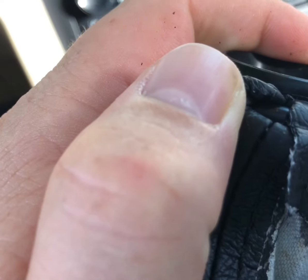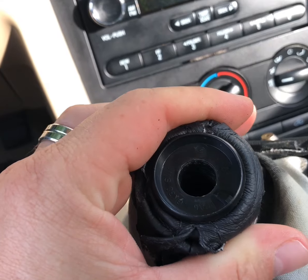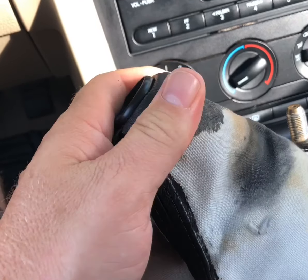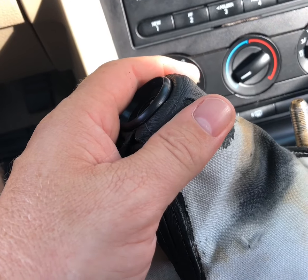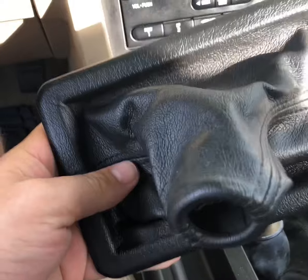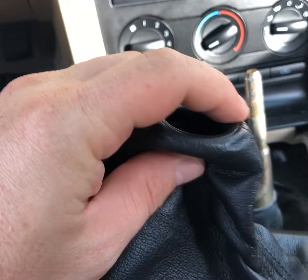There's the shifter band and you just pop that off — pry it out with a flathead screwdriver. I would show you this but I can't hold the camera and do this at the same time, so you're just gonna have to see the after effect. And boom — there it is, it's off. Very simple.